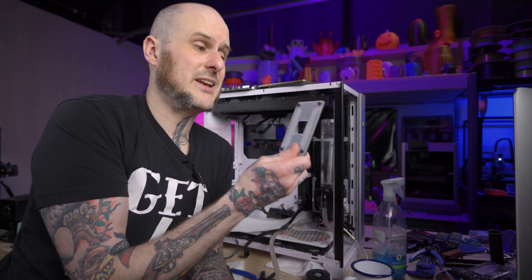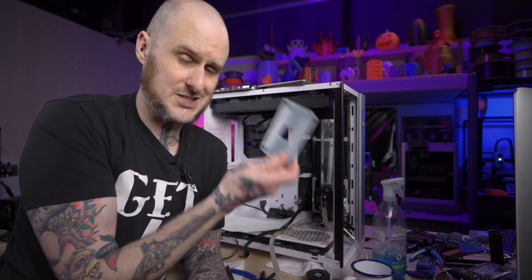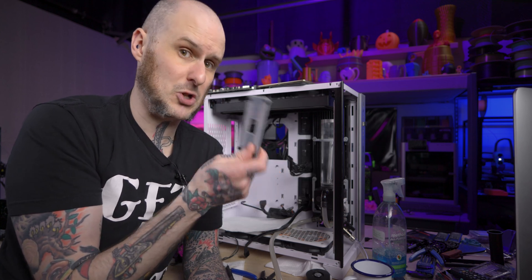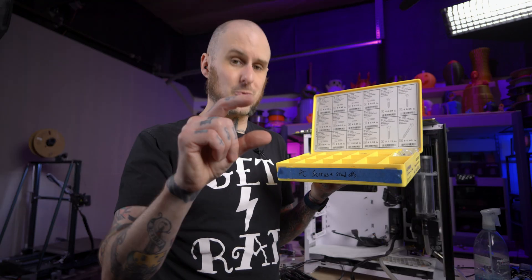The original AMD back plate — I checked it with a tap and die set and some thread gauges, ran a tap through it already. This is 6-32, so I need to come up with some longer 6-32 screws to replace these ones. I got lucky — I had a bin that's all PC screws: motherboard hold-down screws, standoffs, all kinds of things I've taken out of cases over the years. Sure enough, I had an assortment of 6-32 screws for a water block. They look like they came with an old AIO from years ago, but they seem to be just about the right length and they thread into the original back plate. Ruby calls me a magpie, and sometimes saving everything pays off — most of the time it means I have too much stuff.